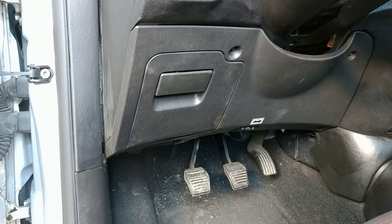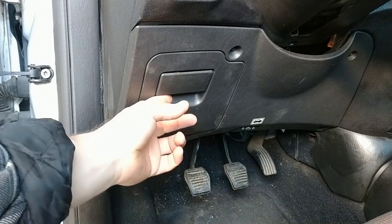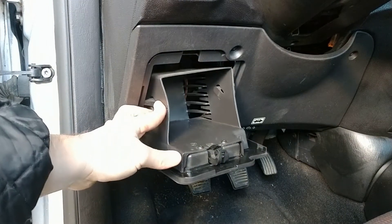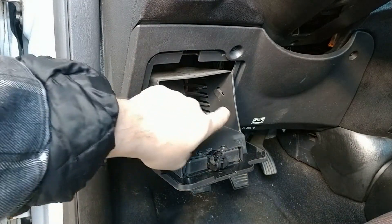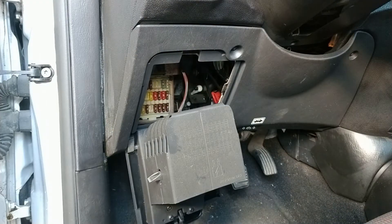What's next? The next thing to check is your fuse panel to see if your fuse is blown. In order to access this fuse panel, because it's the inside one as indicated by the owner's manual, pull this down, pinch the sides of it — each side of it pinches. See the ear? There's one on the other side. The box will come loose, exposing the fuse panel.